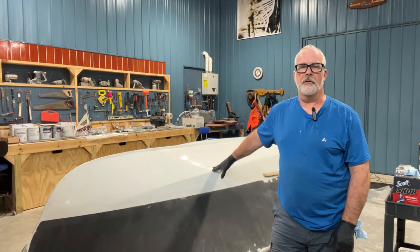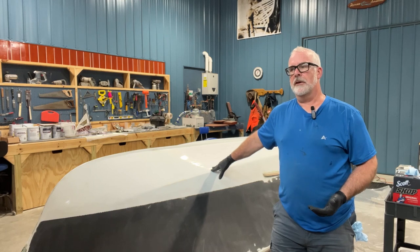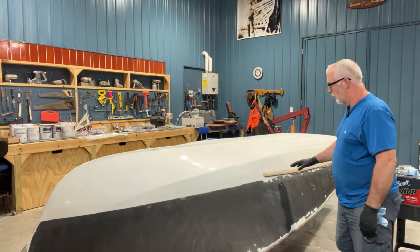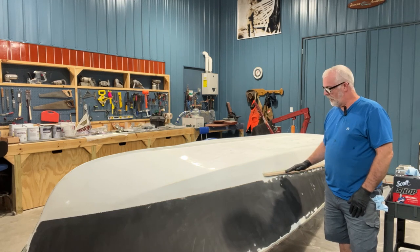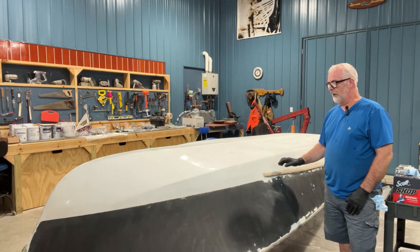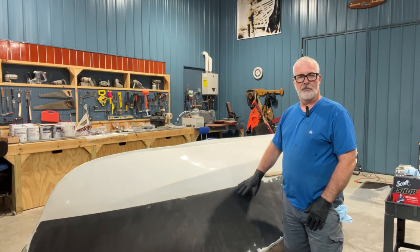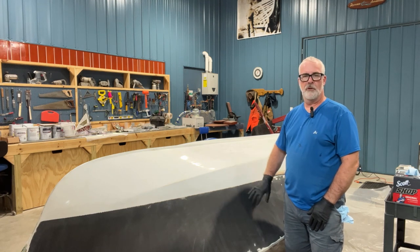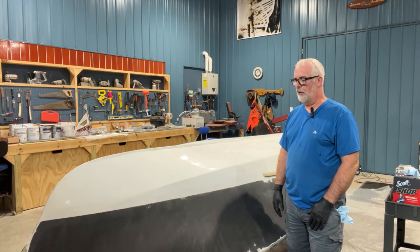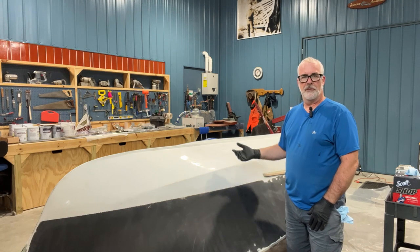Welcome back to Reynolds Runabouts, everybody. This is Jeffrey Reynolds. Today I'm going to put the water line on the boat. The water line I originally found was skeptical — I changed the spray rails a little bit, so I want to do something different with how the spray rail and the water line look. I have to use a laser level for that. Before I put the tape on, I'm going to wash the boat in acetone first so my tape will have good adhesion. It's all been vacuumed, and now I'll wash it down and prep it for both the tape and the primer.